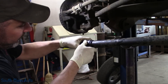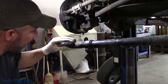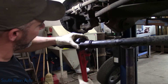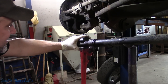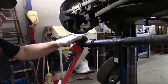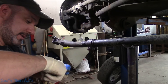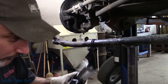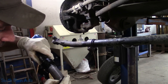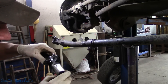I'm going to make sure that pinch bolt is nice and loose — and it is. I've been spraying it down in the crack. Now I don't know if this side is right-hand thread or not. I believe the right side is. I could be wrong. I think it turns as easy as butter — out of here! So I just wanted to grab the new one to see if it was right-hand thread or not before we start twisting. Easiest way to tell is to put your finger on it and spin it — and it is actually left-hand thread.